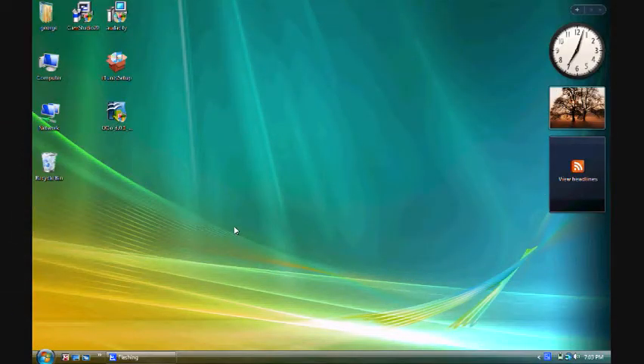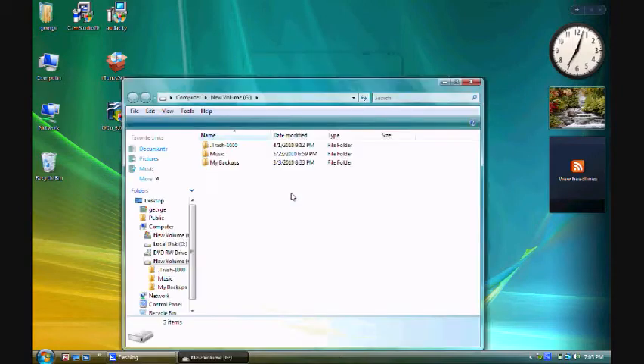Alright, I'm going to give it a go. I'm plugging in and turning it on. And it looks good — everything is here. The hard drive wasn't the problem, it was the enclosure itself. Just keep in mind that once you open it up you're going to void any warranty that you have. However, the warranty is not going to cover your photos — the hundreds of photos you may have stored on there — so this is your only hope to recover your data, outside of sending it to a data recovery company. But if the hard drive is accessible, you'll be able to get your stuff. I hope this was helpful, and if you have any questions about this or anything else, give me an email at info@eastcoastcomputerservices.com. Thank you for watching.